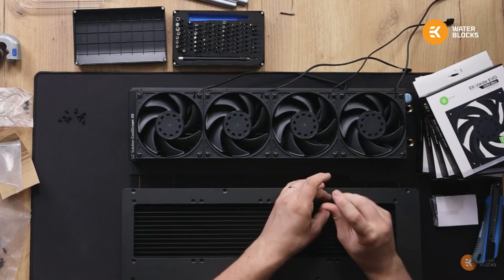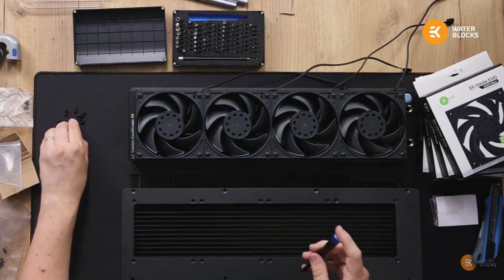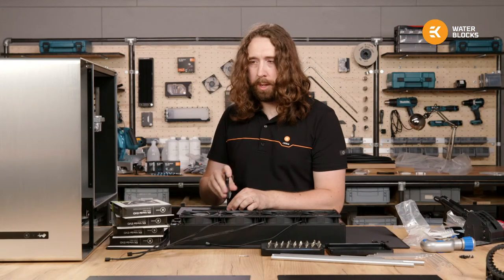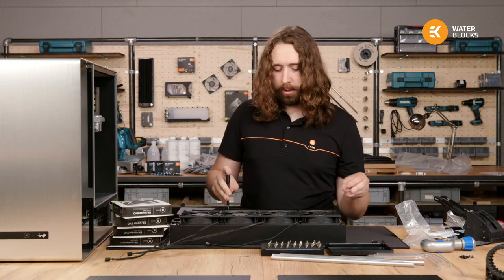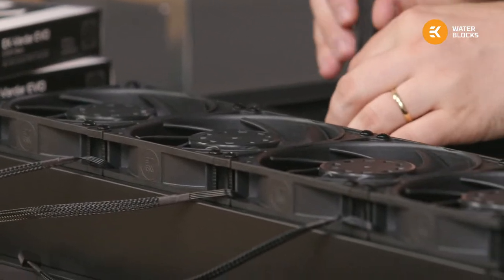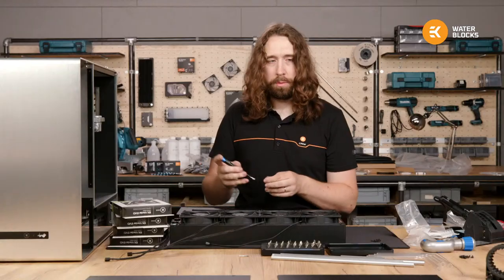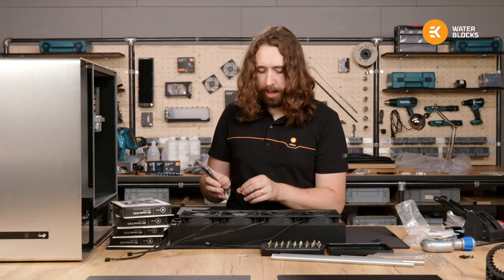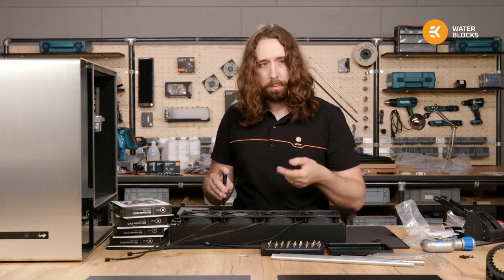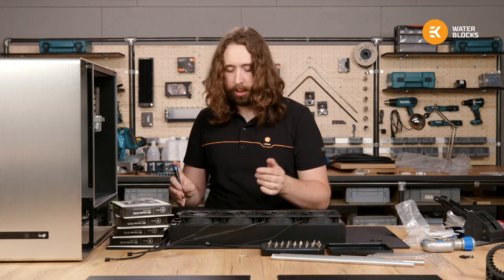The titanium tubing wasn't actually bent by myself because it needs to be bent prior to the plating. The way these tubes were made, they were formed with fixtures and rolled around, and the tube itself was actually machined to an accurate diameter. It's not just raw tube stock, but it's turned on the outside, so it has a really perfect finish. And bent and later plated with the same exact plating as we use on the fittings.